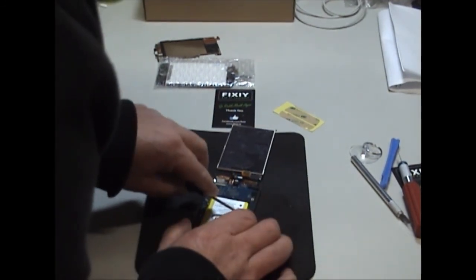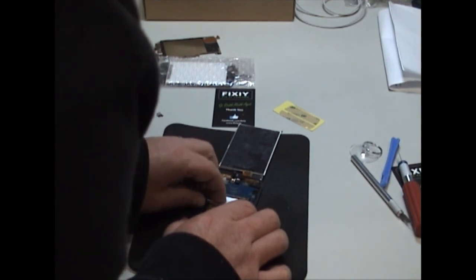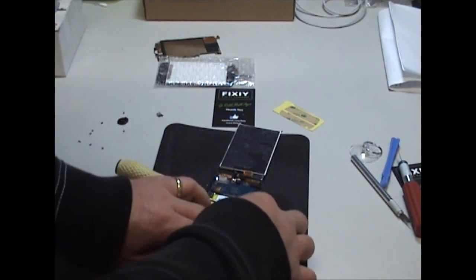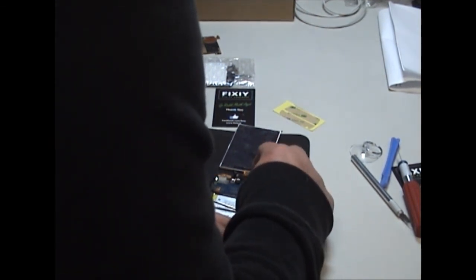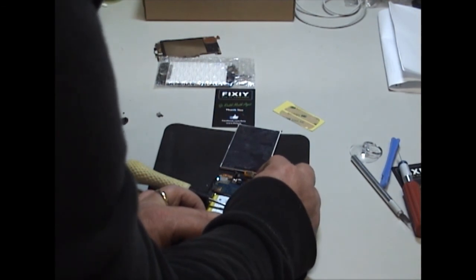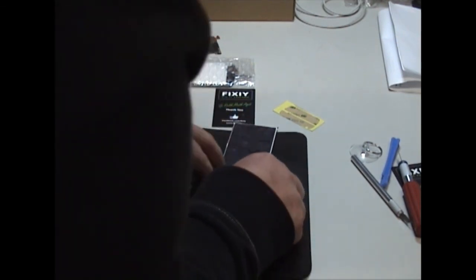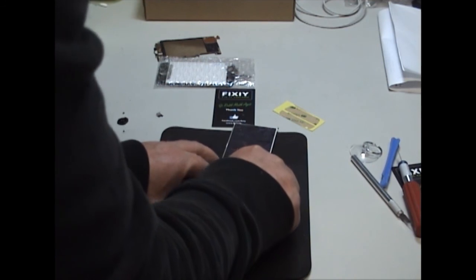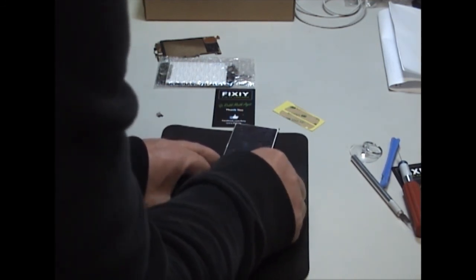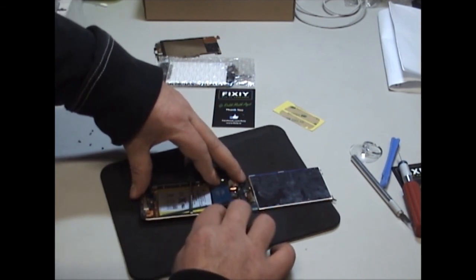So what we do is flat screwdriver straight over to the middle side of the board, in underneath, like that. Have to keep it on the flat for now. Flip back the camera back up towards you. It'll come back up slightly. You don't want to put too much pressure on the board, but you have to put a small bit to get it out. What I do is keep my finger on the cable that I don't want to come up. That's it. So what you end up having is this there from the side.